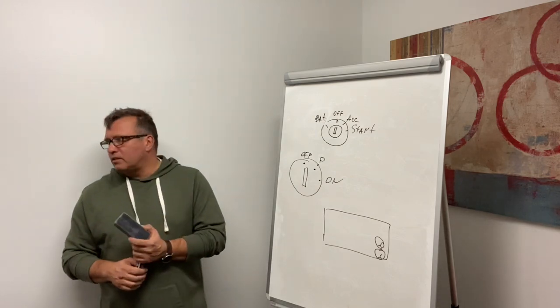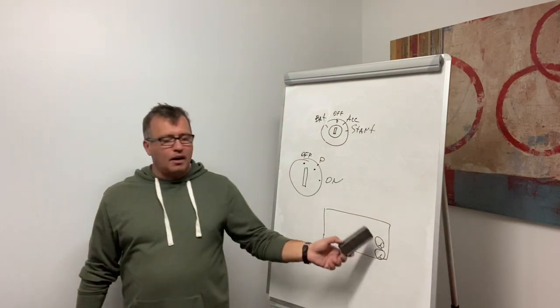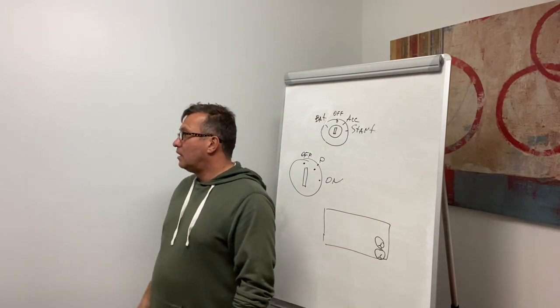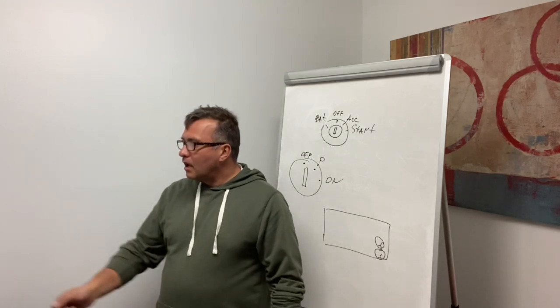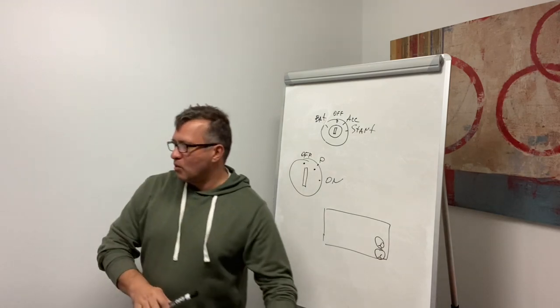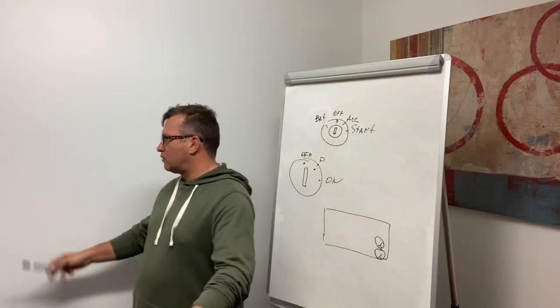One more thing I need to tell you about building up the pressure. So at this point, how are we checking our air gauges? Building up pressure until what? Until what happens? Cuts off when? 120. Between 120 and 140. Never say at 120, never say at 140. Between. That's what it says in the handbook, that's what we're going to say.